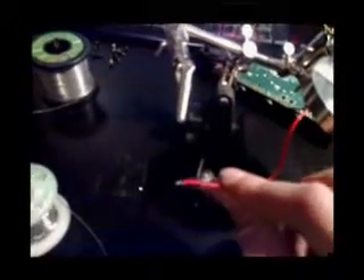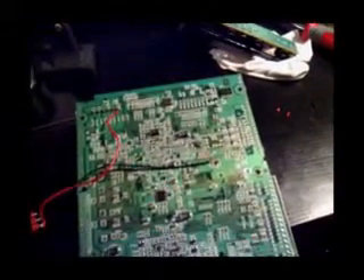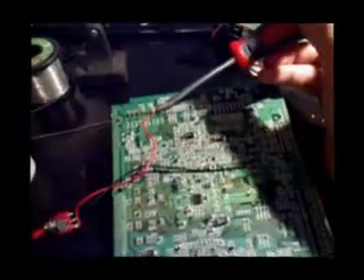The way I wire switches is: hook the wire over, twist it, tin it, hook it over, and solder it to the switch. The red wire will be my 12-volt — tinned — and the black wire will be the part that solders to the board. This wire is probably a little bit thick but I think it'll be all right. I've also prepared the joint on the board — that took about two seconds. Mod is done: one side of resistor 512 to 12-volt up there.